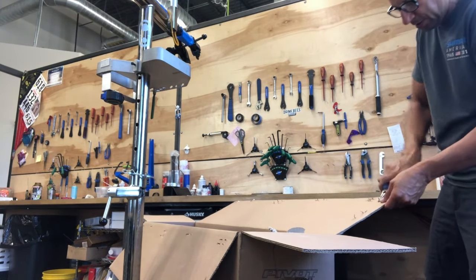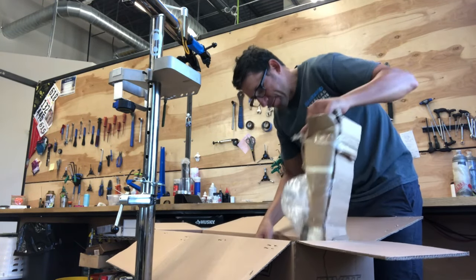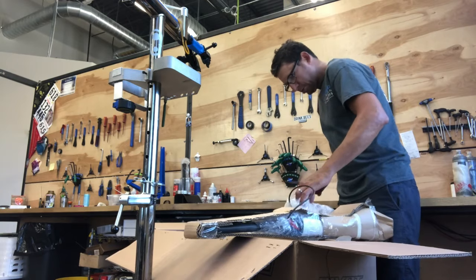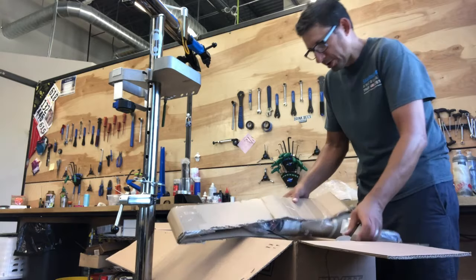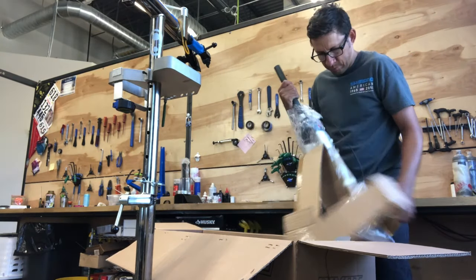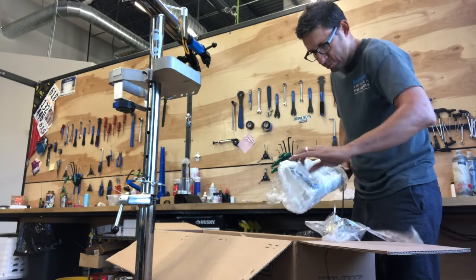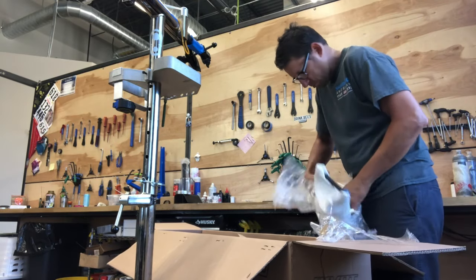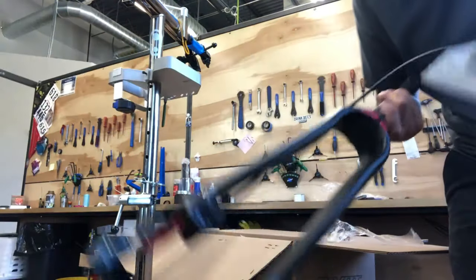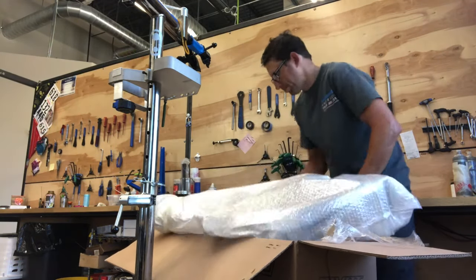It's got a carbon frame and carbon Reynolds wheels. Go ahead and get those staples out — you don't want to be scratching your new bike getting it out of the box. Everything is packaged really nice. Typically all the Pivots I've built have been mountain bikes, but it's kind of the same with Yeti — you basically get a frame and a build kit and put everything together. Normally that means installing the fork headset, cutting the steer tube, putting the bottom bracket and cranks in, and routing all the cables. But this one was nice — it's got hydraulic SRAM Force brakes, internal routed fork and frame, and everything was basically already routed, hooked up, bled, and ready to bolt on. Hoses were all cut to the right length — pretty big time saver.